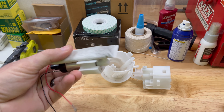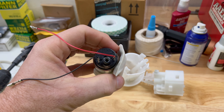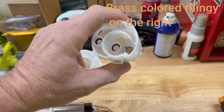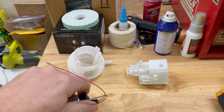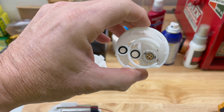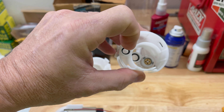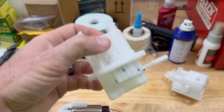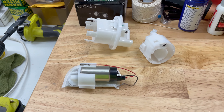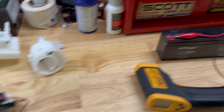Is that fuel helping keep it cool? Possibly. The way this fuel pump works is it draws fuel in through that filter inside the sump, pressurizes it, and there's a built-in three-bar pressure regulator — right there. It pressurizes the fuel up through the top, and if it exceeds three bars the excess comes out the fuel pressure regulator. The regulated three bars of fuel pressure goes out to your fuel injection system. That's the Himalayan fuel pump in a nutshell. Let's hook it up and monitor some temperatures.